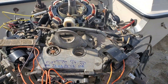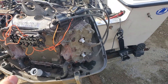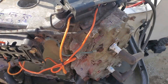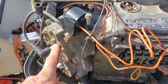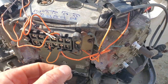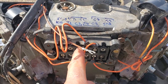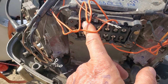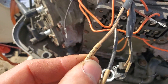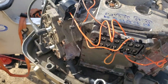This is literally the quickest way to diagnose intermittent spark on one or more cylinders. This applies to more than one cylinder — let's say one and two were bad but four and three are perfect. We can just take any of these trigger wires and one at a time test all the channels with what we know is a good set. Change the input, change the output, and just make sure that whatever cylinder number is in the pack on the trigger side is matching the cylinder side on the motor.